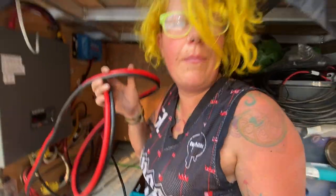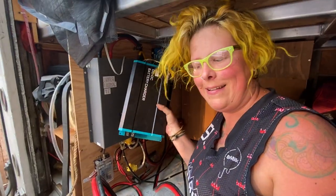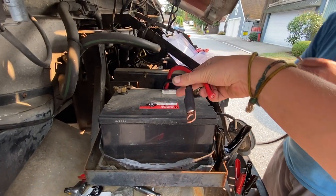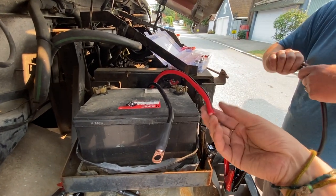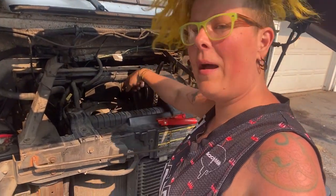Okay. This old beast here will get attached to this guy. Nice thick 4-gauge wire. These travel all the way to the back. Oh, I should put a lug on this. I was totally under the impression that something had to connect the alternator in here, but actually everything comes through from the battery. The alternator will charge the battery, we take it off there.